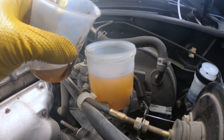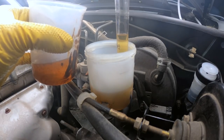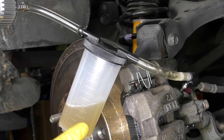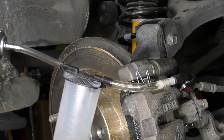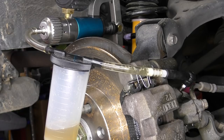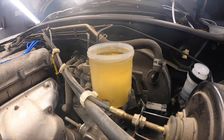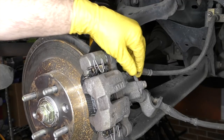Next, let's go ahead and get our brake fluid serviced. We're going to start under the hood and extract as much old brake fluid out of the reservoir as we possibly can — something like a turkey baster works really well for this. Once you get as much out as you can, go ahead and top it up with new fluid that meets your car's needs; in our case we're going to be using DOT 4. Then we go to each wheel and pump the brake fluid out until the fluid coming out of the bleeder is clear. We are doing a brake fluid flush here, not bleeding the brakes — the order is not quite as important.